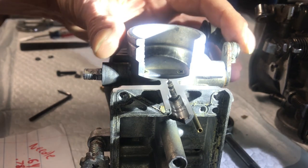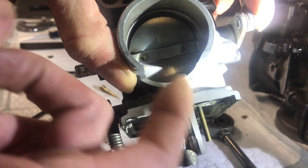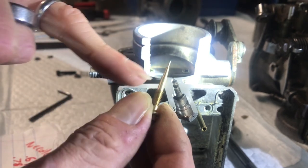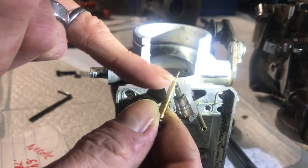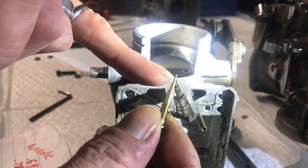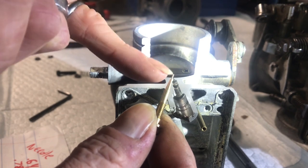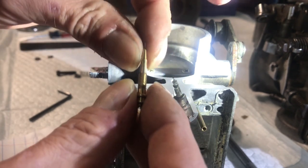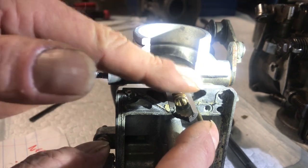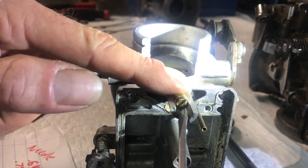While we've got it apart, it's neat to see what's going on in there — normally you can't see it because it's covered up in aluminum. Right there is the hole that the fuel flows up through to go into the needle area. This bigger taper up here is not very important; it just has to be clear enough to let the fuel out. The important one is this little tip on the end — it needs to be nice, straight, and smooth. We worry more about this little end than any other part.